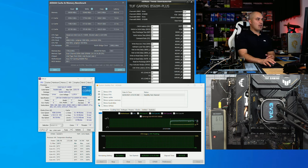I was able to achieve a good memory tune: 3600 MHz C14 with very tight sub-timings in gear one mode. Note that you can't manually select gear one or gear two in the BIOS — it defaults to gear one. This is actually a bit better than the MSI Z590i Unify, which has a bad BIOS right now; I was stuck at 3333 MHz for gear one mode on that board with this CPU.